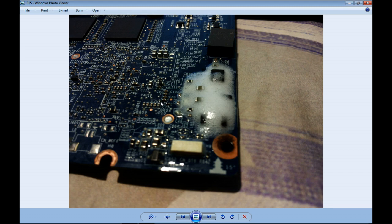If your electric appliance, your electronic equipment, laptops, telephones, tablets, get troubles with water, the first step is to disconnect the battery, and the second, look for an electronics technician or engineer who can fix the problem. What I'm doing here is using chemicals to try to stop the damage that the water is producing on the board. By the way, I can stop the damage at this point. I cannot correct the damage that is already done by the water. I have to do it in another way, but I will not revert the damage done.